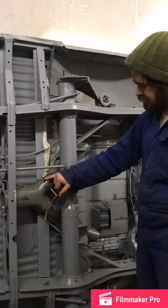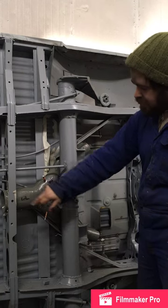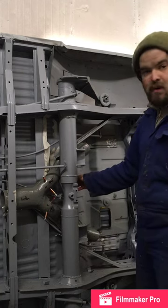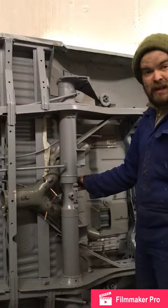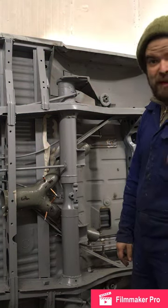It's in there now. I just need to put some welds around — I'll just tack it back on where I've cut it — and then join it to the cross member and the floor. Next time I'll put it in before I take the floor out and chop it into three bits. There you go — it can be done.